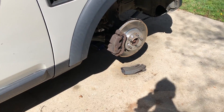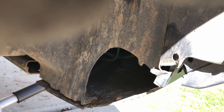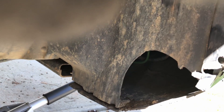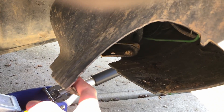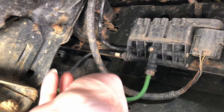The first major question is where to splice in. I'm going to come in here at the front air transfer block. I'll take out a couple of the nuts and pull back to access the two airlines off that transfer block. I took one screw out of the bottom right here in front, which lets me pull this back. I think this will give me enough room to access the lines I want on the block.